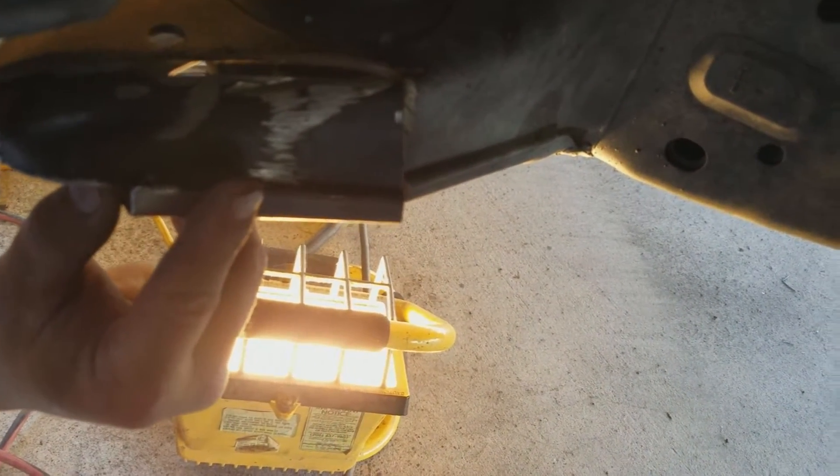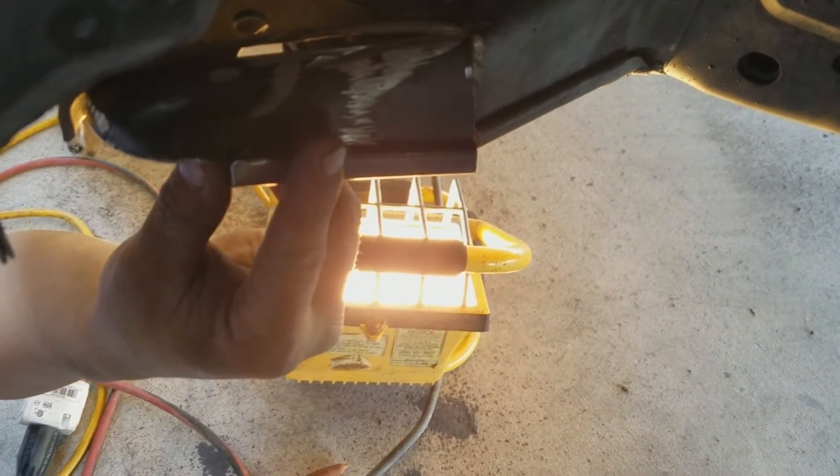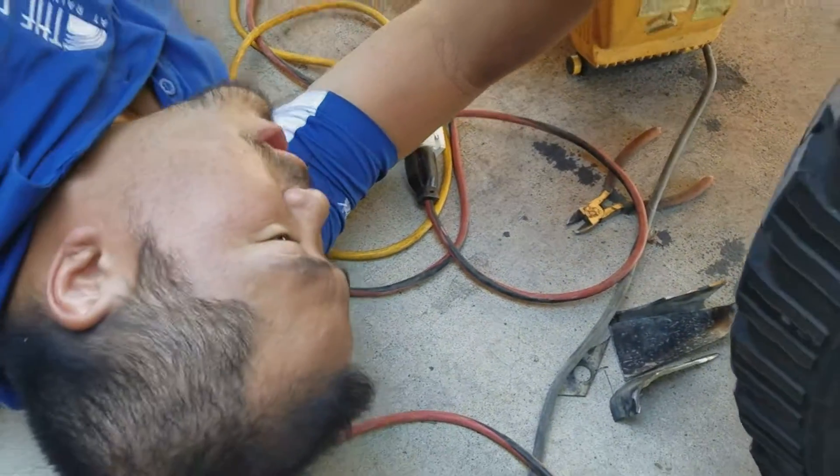The body mount that's right behind the front nose of the car. According to most Toyota owners, whether it's 3rd, 4th, or 5th gen, this body mount always interferes when you either do a lift or put spacers on for your larger tires.